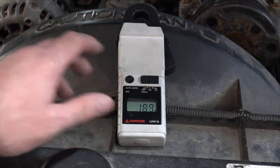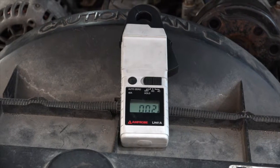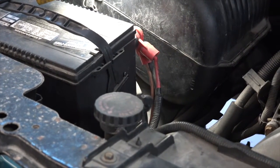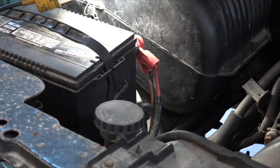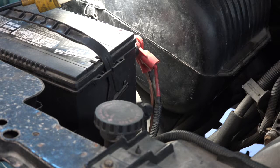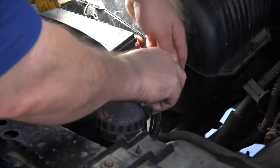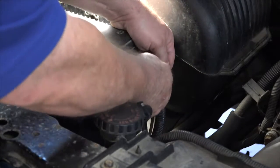I'm going to hit the zero again. We're going to go ahead and place this around the battery cables. I've got the positive side here; the negative side is kind of buried, a little hard to get to. I've got three cables coming out of this positive side, so I'm going to need to make sure that this inductive current probe goes around all three of them. I need to capture current through all three — I don't want to miss any. I'm going to open the clamp up, put it around the cables, and attempt to make sure that I capture them all.